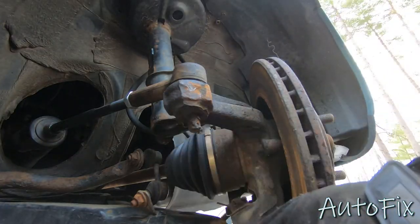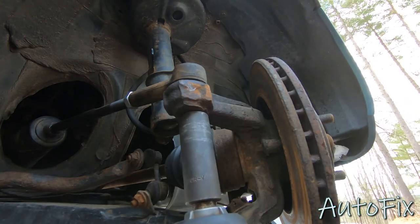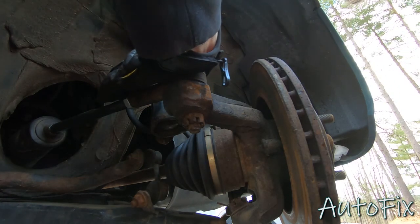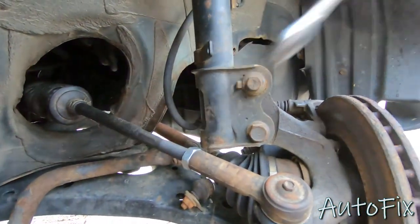Next, you're gonna put on your castle nut. Just make sure it's started by hand, not cross-threaded. Again, torque specs for this are gonna be in the description if you want them. Before you go off to the alignment shop, snug this up while you drive down the road so you can be nice and safe.